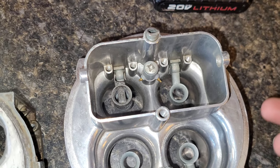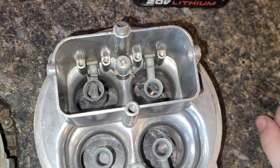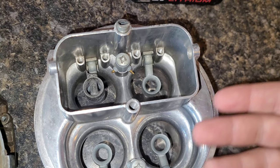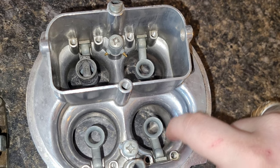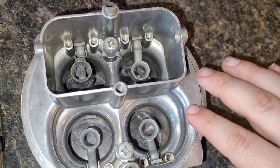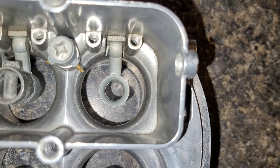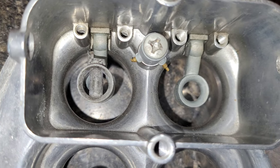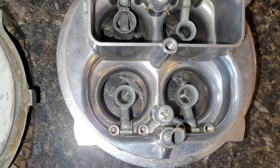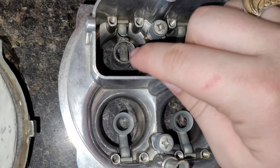Removing the crossbar from the straight legs is kind of an iffy one, because the bar is built into the design — it's the thing that helps it pull fuel out. If you compare the straight leg with a down leg, its closest competitor, you can notice a few differences. Besides the down leg being lower into the venturi bore, the opening in the center of the down leg is smaller than the straight leg, and there's a whole lot more taper and flare on the tops of the down legs.